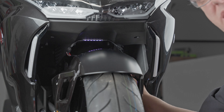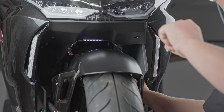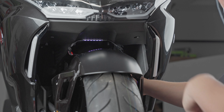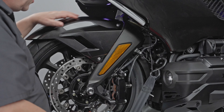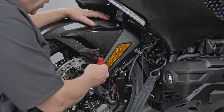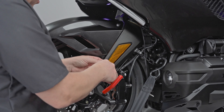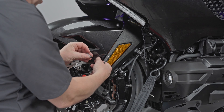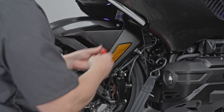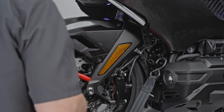Now let's tie off these wires. I'm going to give the wire a little bit of slack down by the brake line and put a zip tie around it there — that'll be our base to work up from to where the LED is. To get our wire lead up to this area, we're going to need to take the fender off. It's simple — just these four bolts. Something to remember: the bolts on the bottom have a plastic nylon washer — keep that. The top bolts don't have a washer at all.